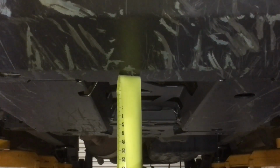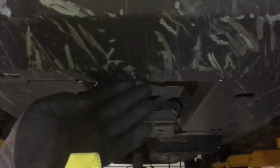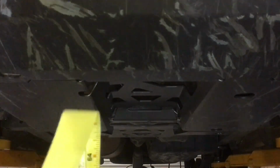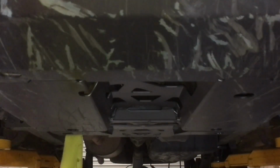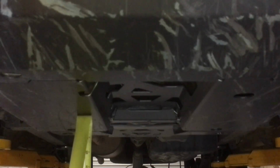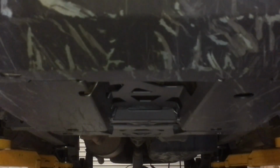We're going to do the same sort of estimate with the replacement plate. 1710 on the front part of the plate, that's not going to change. The transition, when we put the diff drop in, it's the next plate that comes down a bit, right? So we're possibly more interested in this area about here. Again, we've got that tape as level as we can, and we're about the same. It's exactly the same measurement. 1710, right? It kind of folds on 1715, but by the time you straighten it out, it'd be 1710. My money's saying 1710.